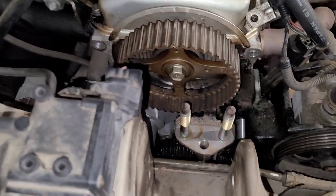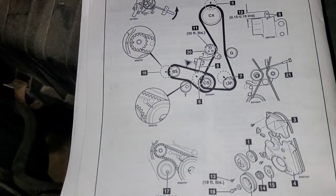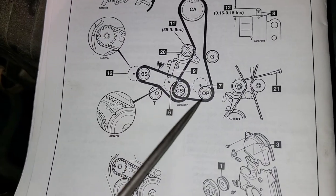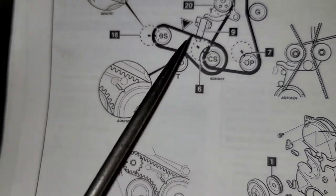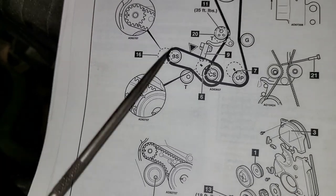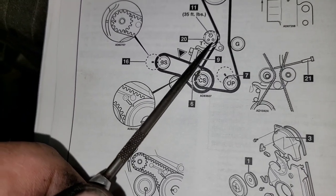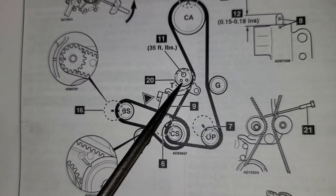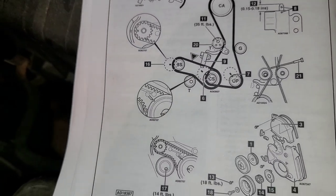I got the power steering bracket out of the way so now I can get to that pulley to change it. I'm going to change that pulley, clean it down, and get the pump bolted up. The water pump is in place. The reason that top bolt is loose is that's the bracket bolt — I just put it in there to make sure it was lined up with the threaded hole before tightening all the other ones down. I've seen it happen where you tighten all the other ones down, go to put that one in later, and the hole is off just slightly and you can't get the bolt started.